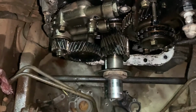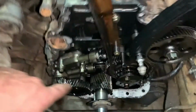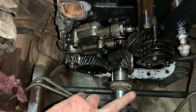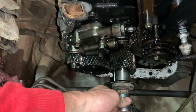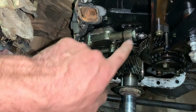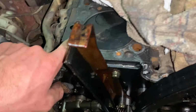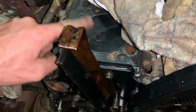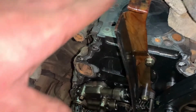Anyway, so what you need to do is take off the timing chain. Fairly simple. Focus. There we go. Take off the timing chain, which connects over here. It ran up with the guides over here. And then you basically turn your crank with the bolt in. And then I've got the socket, it's a 23. So you turn it until you get your timing right. And then timing right, 5th gear, lock the brake. And then you know your engine's in time now. And I can verify that by telling you TDC is sorted. I'm pretty happy with TDC right now over that. So we shall leave it at that.